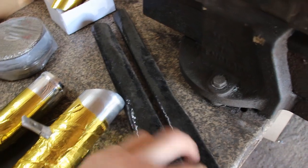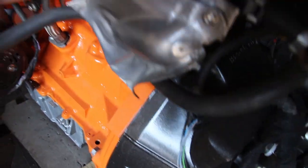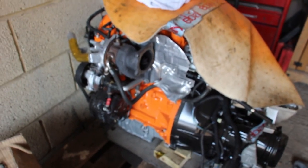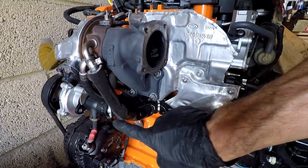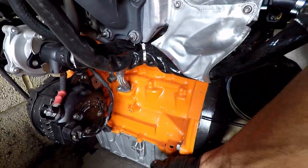And these 2 bits of fiberglass silicone pipework are going to go on some coolant pipes, namely the ones that go by the exhaust. This one here and this one back here. So down pipe gets wrapped, these 2 get wrapped, and that should keep some coolant temperatures and engine bay temperatures under wraps as well. Under wraps, ba-dum-bum. And then we've got our 2 wraps running on the 2 pipes along to here. I've done this because the main down pipe will come down here and pass.